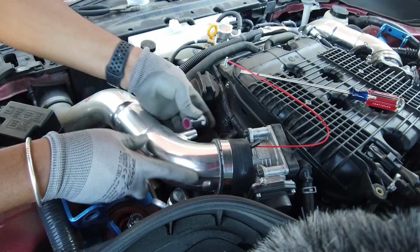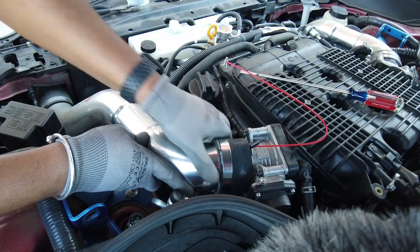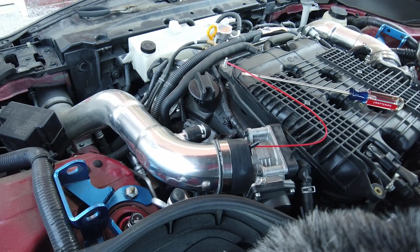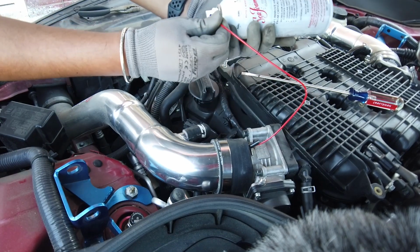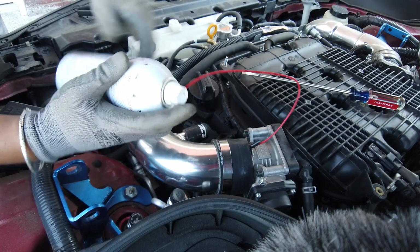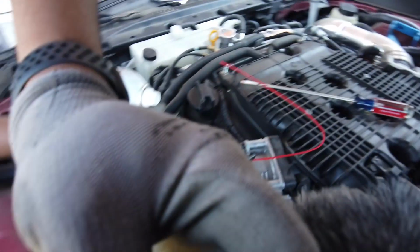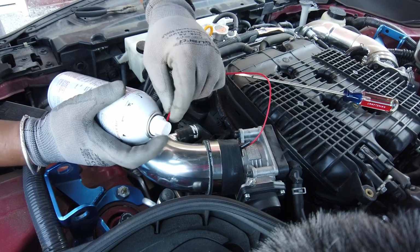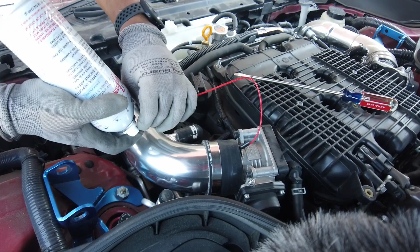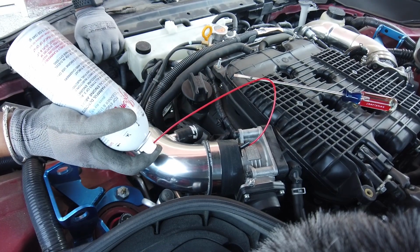Okay, whew. So that's in. Put that there. And now we get our awesome assistant, Mr. Xavier, to start the car. Alright. Plug in the can. And the thing is, the Seafoam, it's okay to spray upside down. Oh wait, yeah, take a look at the smoke from the last application. Okay, so we plug in the can. Alright, when we start spraying, it should drop in a little bit, okay? Give it a little gas. A little gas. 2000.